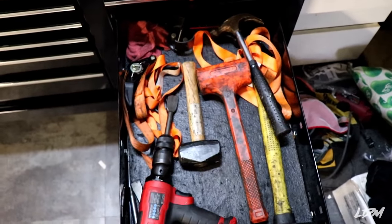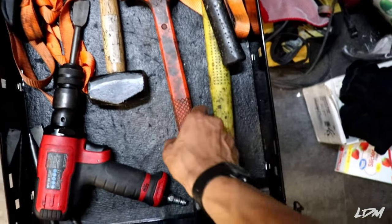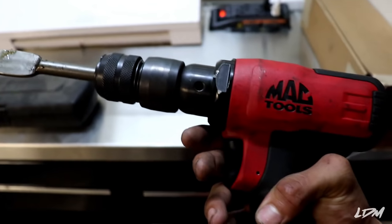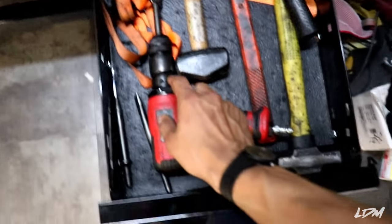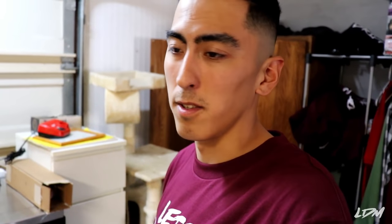Next is kind of the carpenter's drawer — hammers and mallets, all Harbor Freight. You don't need to buy a Snap-on mallet; you're just going to be hitting with it. The air hammer is super badass — I use it all the time for breaking things loose or splitting something open. The pointy bit is great for CV axles — just push it right out of the hub. Highly recommend a powerful air hammer. Harbor Freight ratchet straps are also really handy — great when you need to pull the knuckle away to give you more room while dropping a transmission or pulling axles.